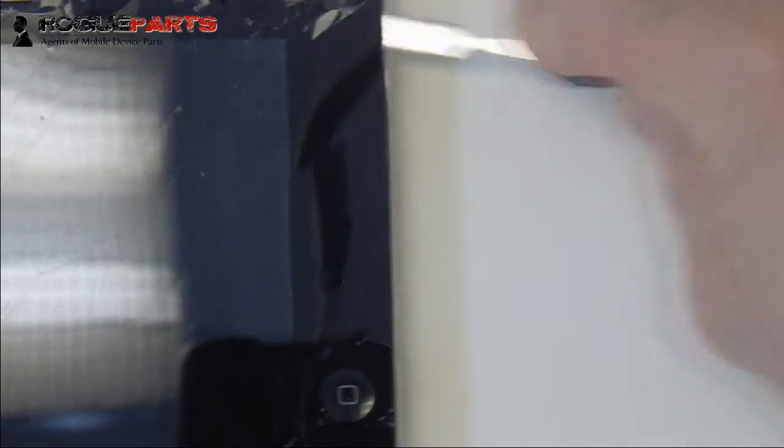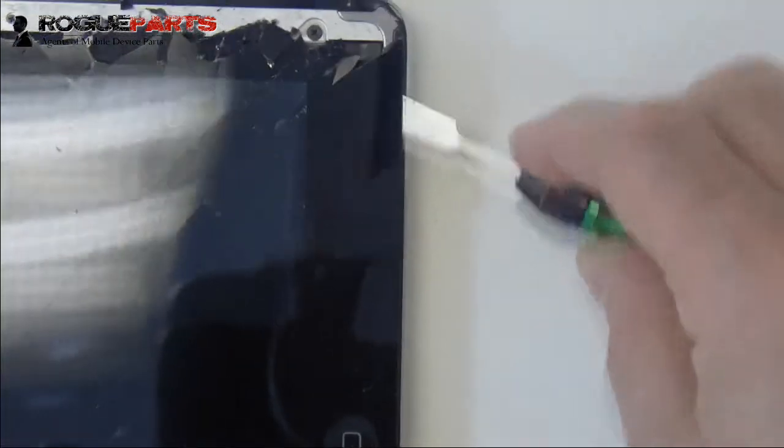There's that Wi-Fi antenna. It's not totally stuck to the reverse end of the digitizer like it was in the iPad 2, a very, very difficult situation to get around. But it can get stuck to the digitizer when you lift it, so it's important to be careful around that area. That's why we're giving it enough heat, right? So we got the heat on it. We're blasting it with 1050, not keeping it in the same spot. You want to be careful not to hold the heat gun over the home button in any capacity, because you will melt it. Okay.